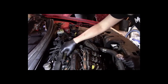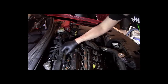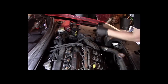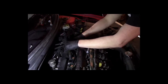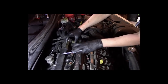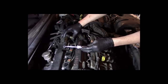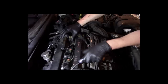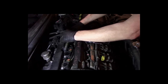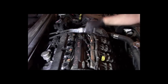Goddang it. So this car has an electric problem where the alarm goes off at random. Another thing I'll have to fix, but now it's worth fixing. We're going to plug this coil in, put a test light up to it. Nothing. Absolutely nothing. This is a dead coil. I'm even going to put my finger there. Nothing. This coil is dead. That's all it is. So I was wrong, and I am glad that I was wrong.